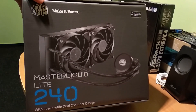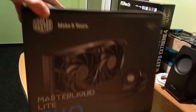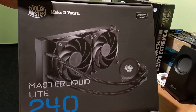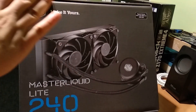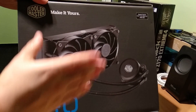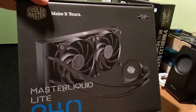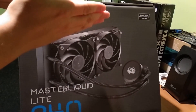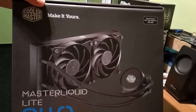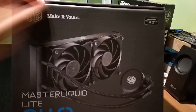Hey guys, Zoltan here and this is the Cooler Master Master Liquid 240 Light. Technically this is my first liquid cooling solution. It's a nice compact thing — you don't have to do anything special caring about pipes or pumps or anything else. Basically you're just using it like simple air cooling, a bit different. You have to attach this to the CPU socket and also attach the radiator to your PC case. It supports the AMD AM4, so the new Ryzen I guess, and for me the important part is the LGA 1151 socket support.